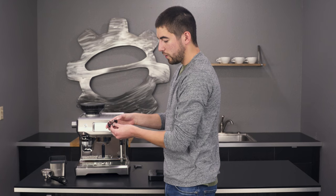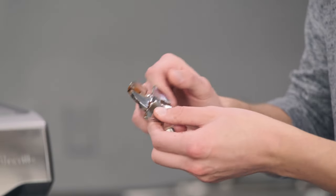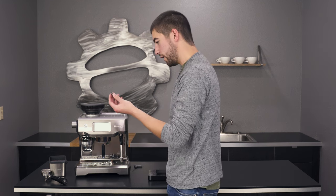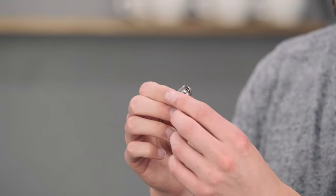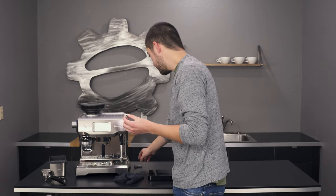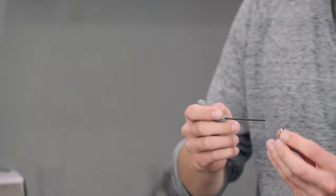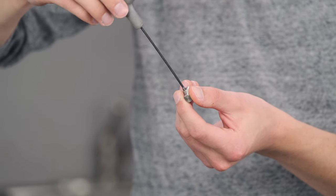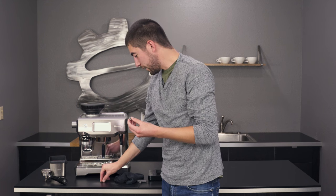Here's your tamper fan along with the tamper fan connector that actually holds it and screws up into place. Now is a good time to just give it a nice wipe down - you can even give it a little bit of a wash. It's nice to keep these things pretty clean to make sure that they're tamping properly. All you're going to want is this connector piece here - it's simply an Allen key screw and some threads. You're going to need a two millimeter Allen key, which should be included with your machine. You're going to unscrew the threaded two millimeter portion - it's just a set screw to prevent this from turning.